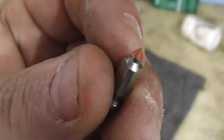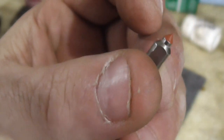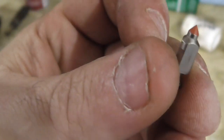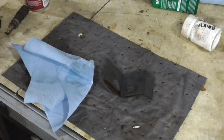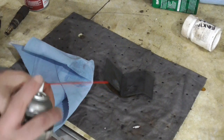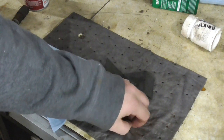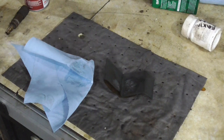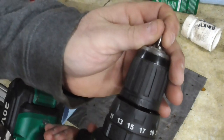Now let's look at the needle. You can see it has a rubber tip — a lot of times you get a groove around there, but this needle looks pretty good, except the tip looks a little narrower than it should be. It should be 60 degrees all the way. Regardless, we're going to hone it. I have 1000-grit sandpaper and I like this Penn grease — it's a penetrating grease that's very thin and then thickens up. I'll put that on the wet sandpaper. You'll notice the end of the needle is round even though it has a triangular shape.